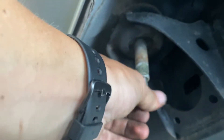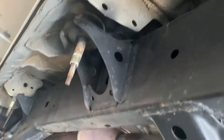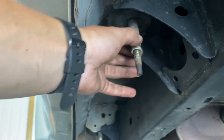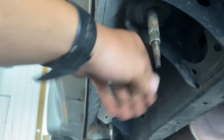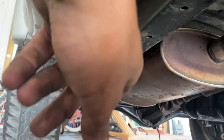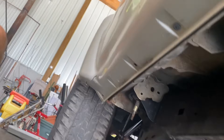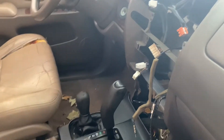Quick tip on these body mounts — sometimes they'll start to spin on you. They kind of latch into a little groove. Just pull down on the washer and the rubber mount on the bottom and it'll stay latched in there so you can get it unscrewed. I broke one of these on the back corner but I don't care because those stay with the body and not the frame. Now I'm gonna get under the hood and start undoing electronics and the shifter.